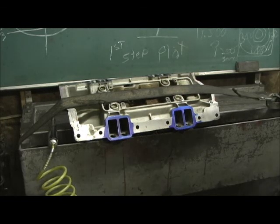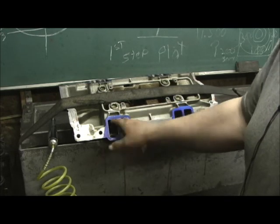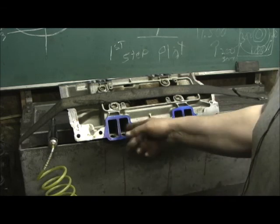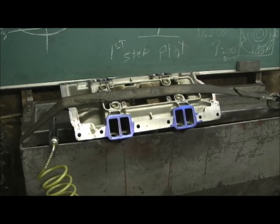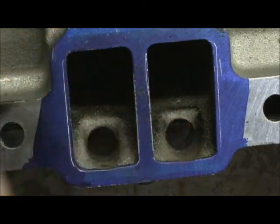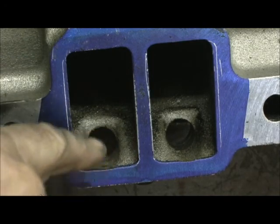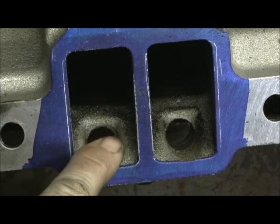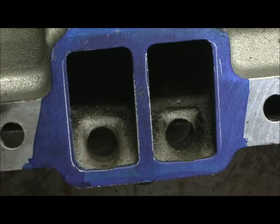Here we are on the intake manifold. This is the factory LT-1 intake, and what we're going to do is go way up inside of here — there's some mods I have to do on the injectors area, that's a wet flow thing. I've got to go in here and open that up, clean all that up, and we'll hit it from the front. Look at this area right here where your injectors are and how they alleviate it in here for the fuel spray pattern. There's tricks you do in this area to help break up and disperse the fuel, because it's really hard liquid from my understanding when it first comes out of the injector, and it becomes a mist downstream.